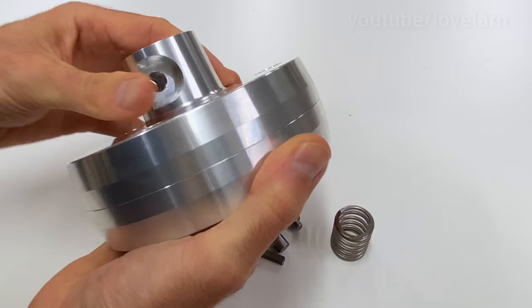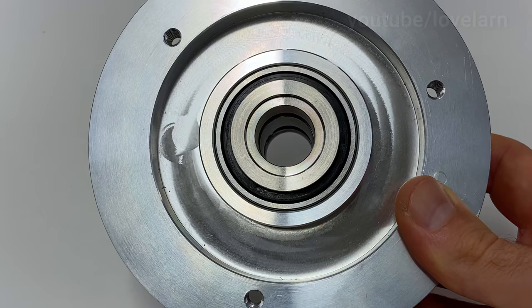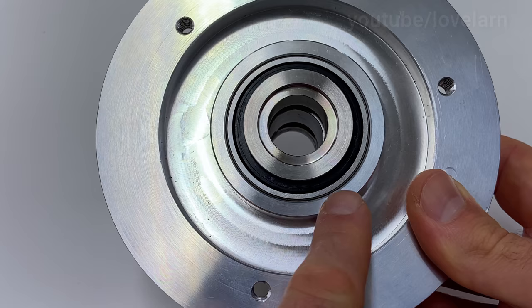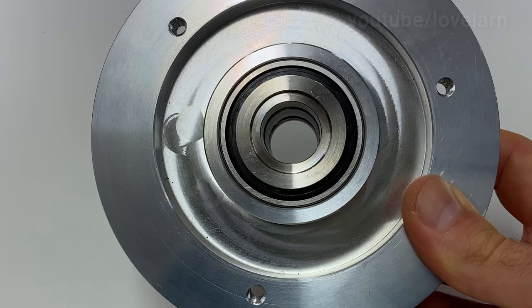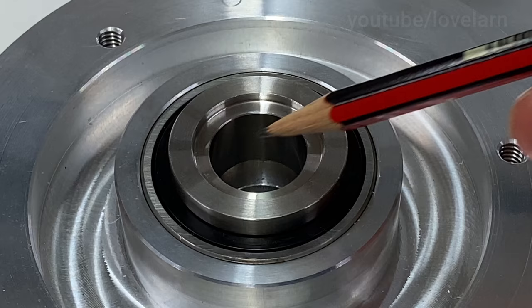Let's look at the internals. Given the opportunity to rethink and modernize this clutch, George has replaced the thrust bearing we're used to seeing — the one with the rounded edge — with a quality Japanese bearing. Unlike the old bearings, these sealed bearings are readily available off the shelf at any bearing shop when it comes time for a replacement in 10 years. George helpfully supplies the clutch with a bearing already installed. This bearing additionally receives a stainless steel top hat which has a spring seat cut into it to receive the clutch spring.